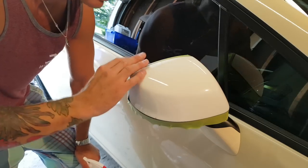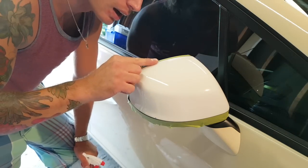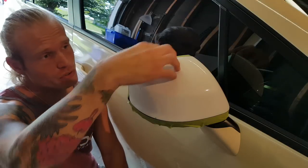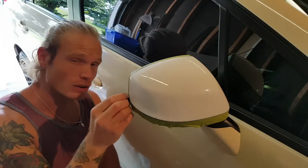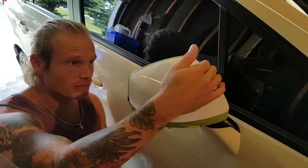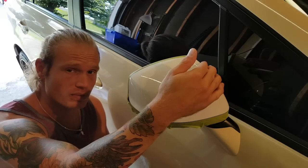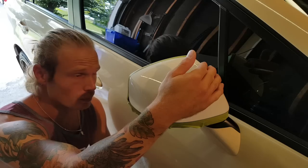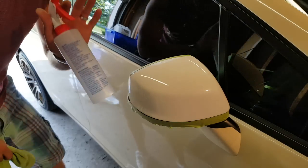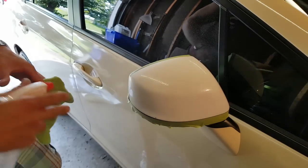What I've done here is masked off the mirror cap around the part that's not going to be wrapped, because what I want to do is trim off and leave about a quarter of an inch so we can roll it around on the inside once I pull the mirror cap off. That's a bit of a trick. The mirror cap pulls off pretty easily on these — I'll show you how when we get to that point.